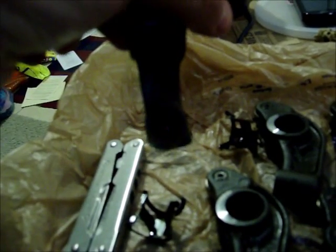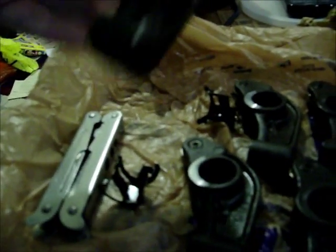You can see that's the rail, and the rail has holes in it. These holes here allow the oil to enter. There's a little hole in the rocker on the inside edge there, and that lines up with the hole over here, so when they're moving up and down it flows oil in there. The lash adjusters go into the ends, into the rocker.